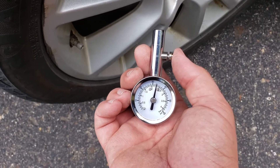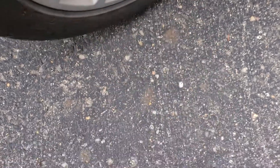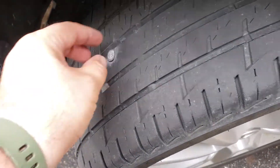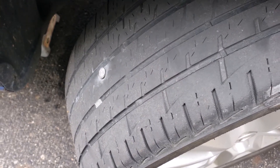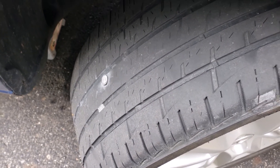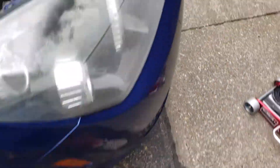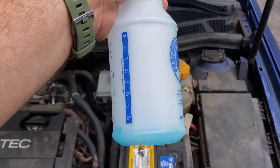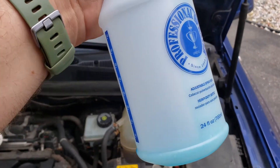Maybe about closer to 34 PSI, but hopefully this isn't leaking. A lot of times if you can catch this before anything bad happens — before it's actually punctured into the inner part of the tire — it may not leak air. My favorite thing to check this with is essentially just a spray bottle with a little bit of Dawn dish soap — not a lot, just enough that it gets soapy — then add a bunch of water to it.